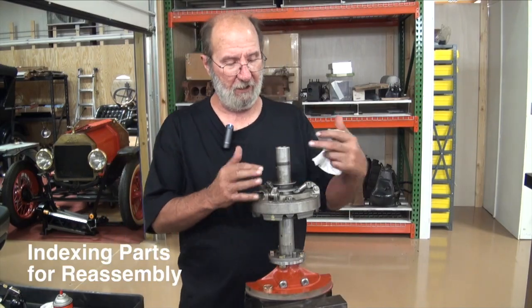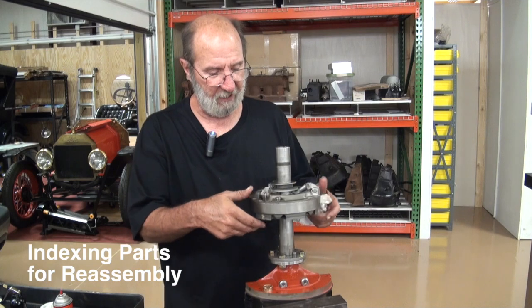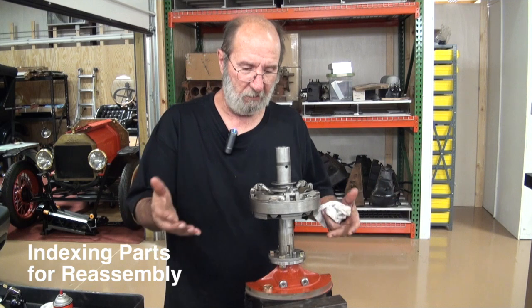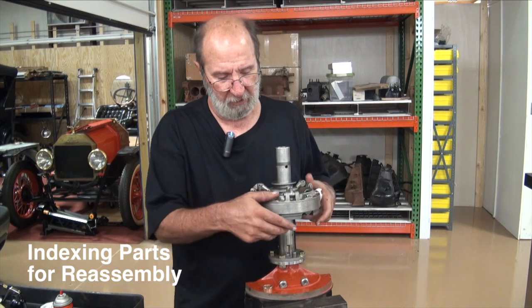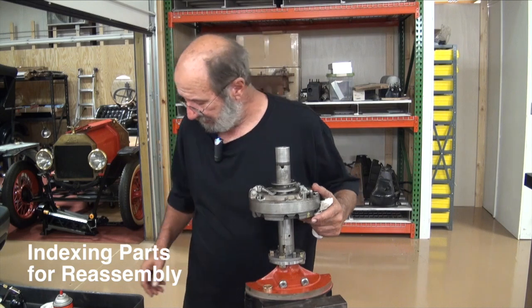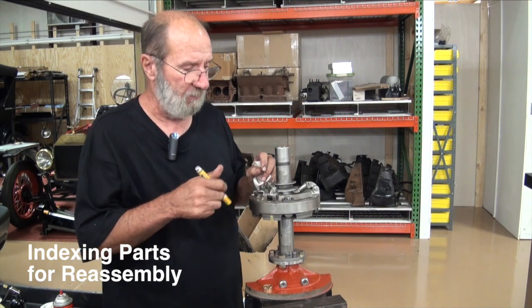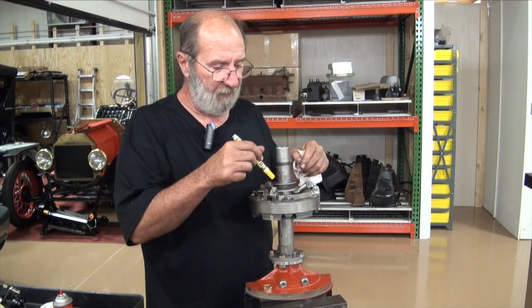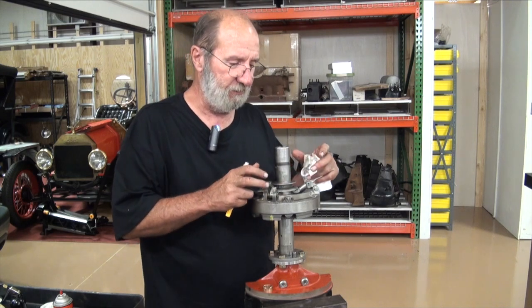We're happy. We've used our dial indicator and we've got three or four thousandths maximum run out — that's rotating the crankshaft around and indexing the brake drum and drive plate around. We ran anywhere from kind of a one-ish to a four-ish, so I'm very satisfied with that. We're going to have things apart here. We got to get the flywheel on and finish building the transmission. Remember there's six different ways that we could put this drive plate around, and if you can't get it centered up, rotate it a hole, index it and rotate it a hole and see what you get.